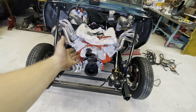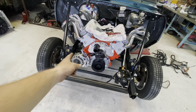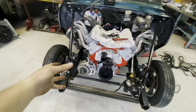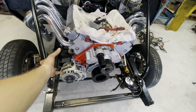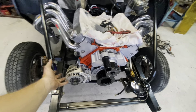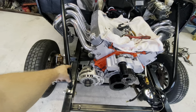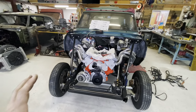Obviously we have the water pump and we can't change that, so hopefully we can just route it around it. That is why the alternator is down there. ICT Billet does sell another alternator bracket that puts it out here when you run an electric pump, and it wouldn't have been in the way. But according to the measurements, this bar would have been in the way, so we didn't do that. Plus I wanted it down low — I'm trying to keep the motor as clean as possible.